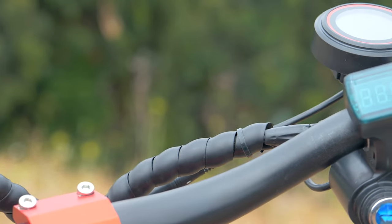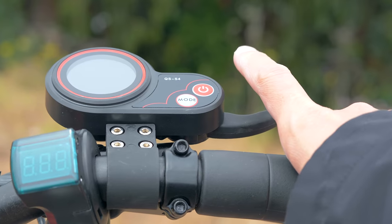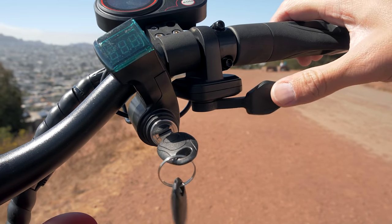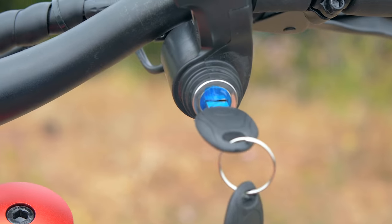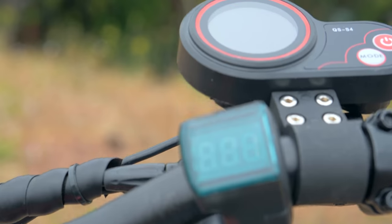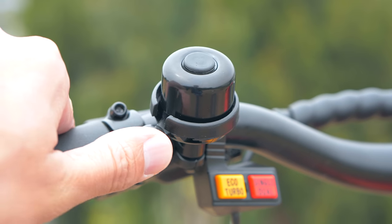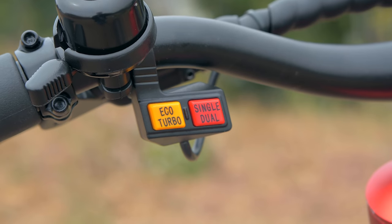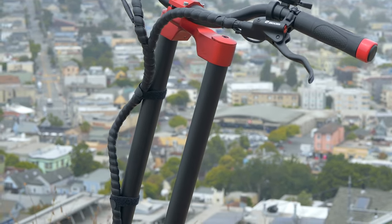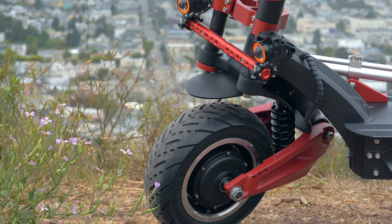You can also enable electronic braking, which can help you slow down even faster. After the brakes, you have your standard throttle and display. I received this scooter with a finger throttle, but I asked to swap it out for a thumb throttle — I find the thumb throttle more appealing on this scooter. It just feels like a higher quality accelerator, even if there's a bit of dead zone on mine. Next to the throttle, there's a voltage display and keyed ignition. The key is a nice touch as a tiny bit of extra security, but definitely don't leave it unattended for long. On the left you have a rather lame bell, and the typical buttons to control eco, turbo, single, and dual motor modes. There's lots of options to control different speed output, but being a speed demon, I'm always rocking dual motor and turbo. There's plenty of extra room to add a cell phone mount and other accessories.